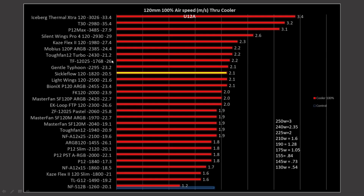At 100% PWM fan signal, the Sickle drops back in performance a little bit. It is still in a good position at 2.1 meters per second of airflow, while the A12X25 is at 1.9. The Noctua is at 19.6 decibels while the Sickle is at 20.5 — that is within my measurement error. However, I do repeat testing and average results, so the Sickle on average is still noisier, even though it's within error of the A12X25. It's pushing more air, so it is up to you to determine if it is worth it. I haven't done longevity testing, but its performance data is there and looking good.